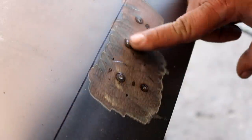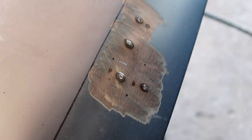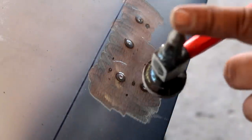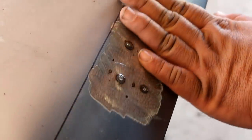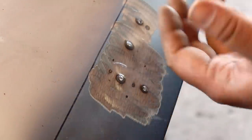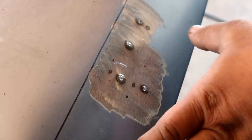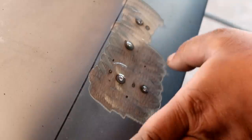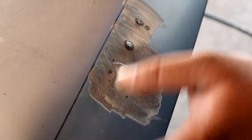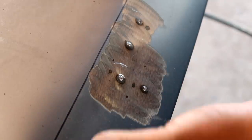I am really stoked. All of this you can grind off, and any part that's a high spot you can use your hammer to tap it back down a little at a time. The rest can be filled in with body filler. The whole purpose of this is to not use a glob of Bondo to fill a big dent. The best way is to pull out most of the dent and then use lightweight body filler, so vibration or people leaning on the car won't crack it as easily as a glob of Bondo under the paint.